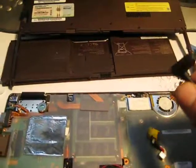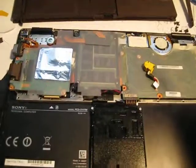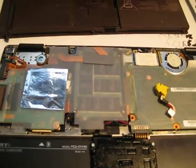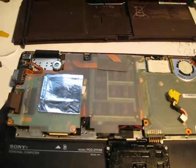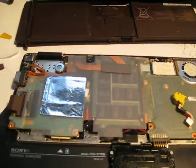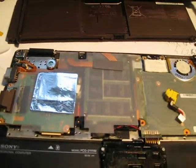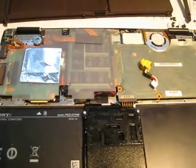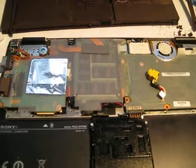Hope you got some of the insights. If you're feeling techy, just go ahead — it's not a very difficult repair. The difficult part is how to take this laptop apart. Unfortunately this one only has eight screws, but some of them can go to 40 or 45 screws, and you also have to open more than just one lid. Before you do that, Google or YouTube the video — try to look up a video on your model, understand how things go, count your screws, make a template of how things are arranged, make photographs. For me it's routine, because I open most models and they have a certain way of putting them together, so I just follow my experience.